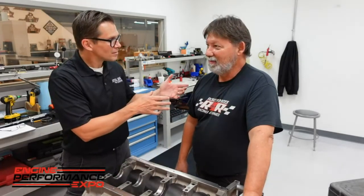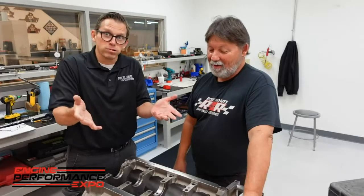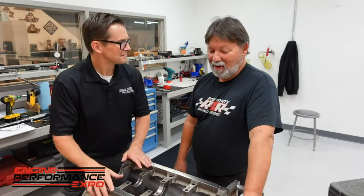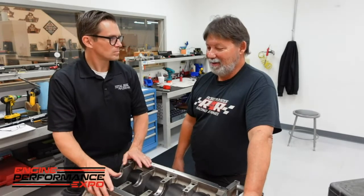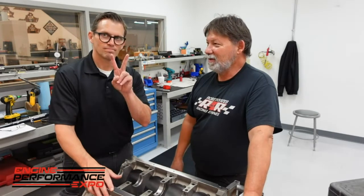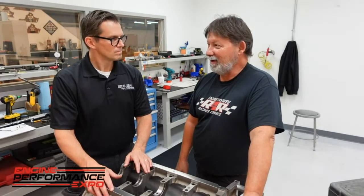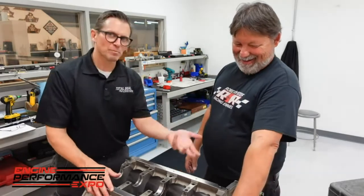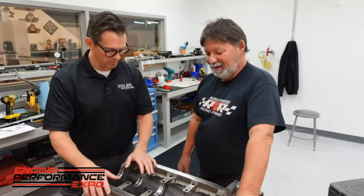Even a little thing like having to hook up the crankshaft with an extra keyway slot in it, because the crankshaft wasn't designed for a blower — and who knew there was a blower crankshaft design? You put two keyways on it so it doesn't spin the hub on the crank. One keyway is good, two keyways is a little better. But if you put enough boost in it, you'll still tear it off. A little extra nitrous, a little extra boost — it's going to end in a bad day.